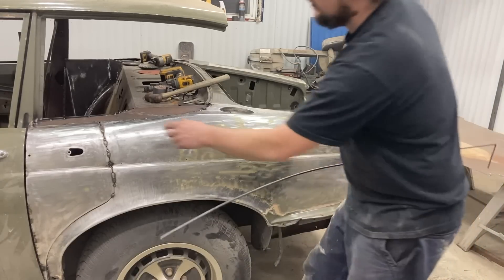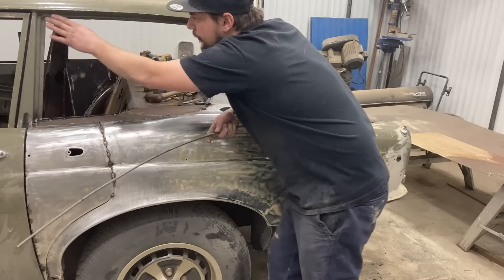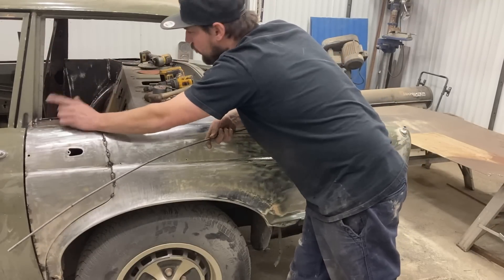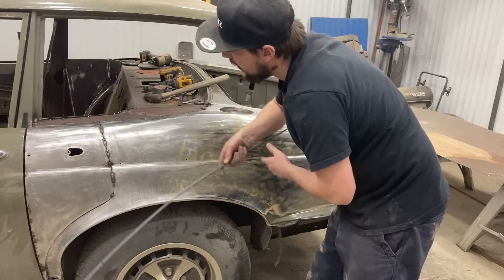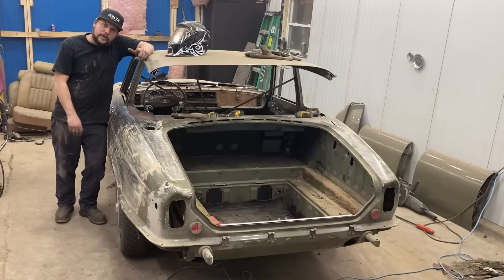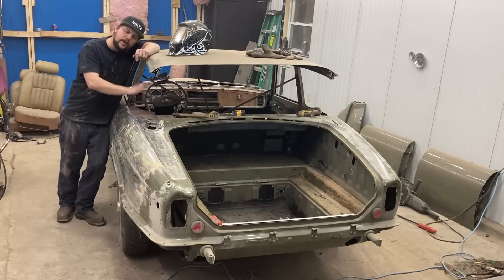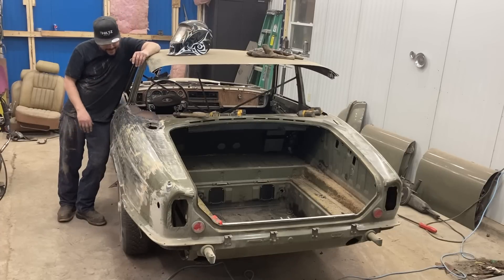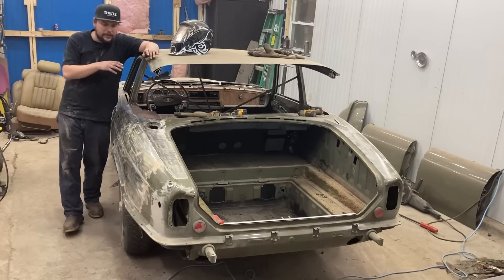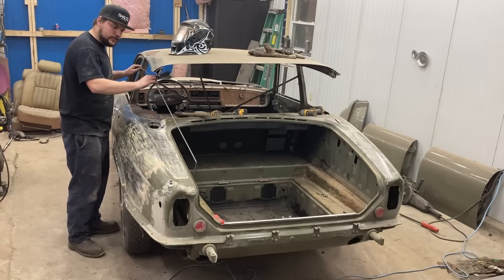I think we'll go ahead tomorrow - I'll roll a piece here and a piece here. These will be welded this side and that side, and I'll install the two tubes tomorrow. Hopefully we'll get the back end tacked up so we know what we're doing for the roof. I hope to have this side welded and the other side in and welded. Like I said, we'll put the tube in and have a look at the roof. I'll show you a little bit from the back what I'm up to with the same template.